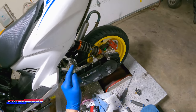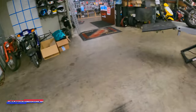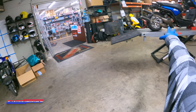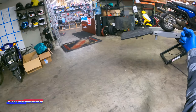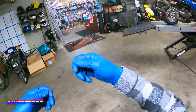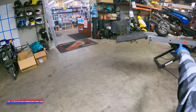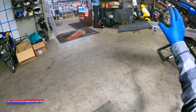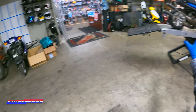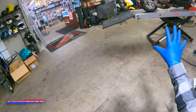Because remember, this is a 6,000, 7,000, whatever dollar motor, so you're gonna take your time. Same with the twin, so think about the twin. You have two carbs, twice as much work, and you have to sync them. So you always have to sync them, make sure they're opening the same amount, get the carbs aligned. So that is a whole nother ball game, guys. This is not a race bike. It's a fast bike, it's a lot of fun, but people that have faster bikes than this, or anybody that wants to talk this down, go tune yourself a twin and then come back to me, because it's not twice as much work.